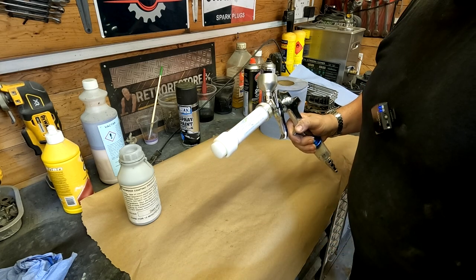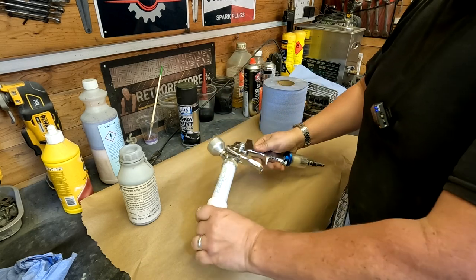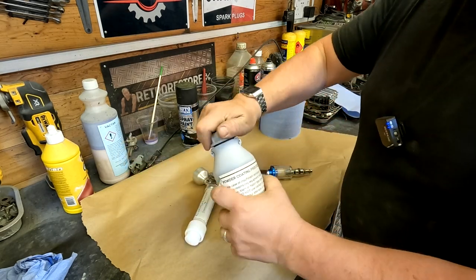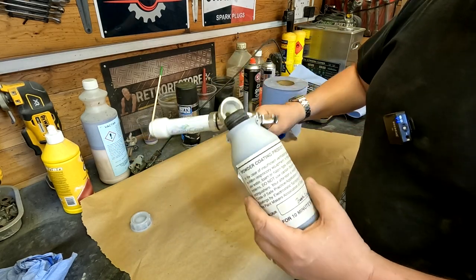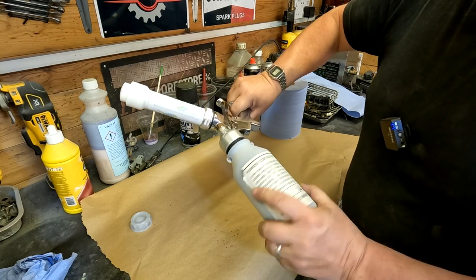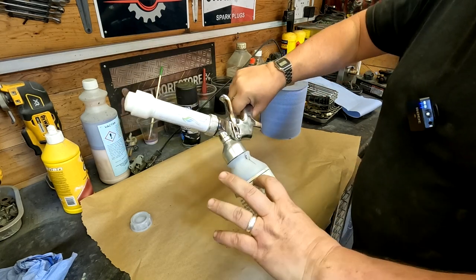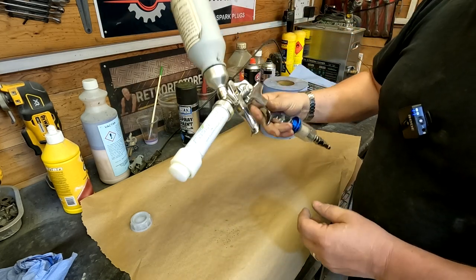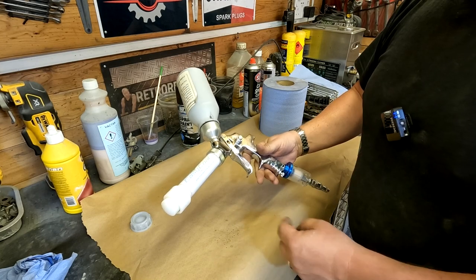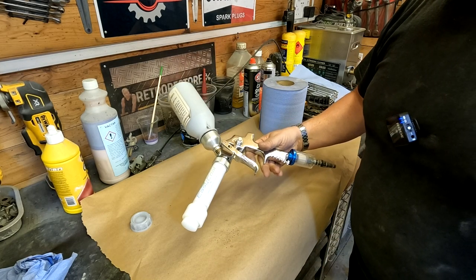Anything you powder coat wants to be connected to you or a grounding system to give it the attraction. So all you do is take your powder. I've got the black gloss one here. I hope there's enough in here. And literally just screw the bottle on to your unit. Make sure it's tight. You want this about half to three quarters full, apparently, for it to work correctly. And basically that's it. Set your compressor to sort of 5 to 8 PSI. Let's go and do the old powder coating.